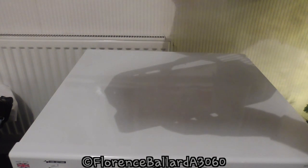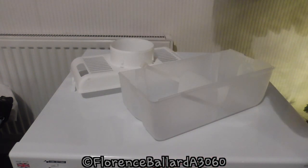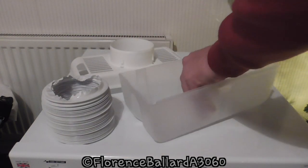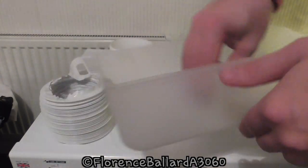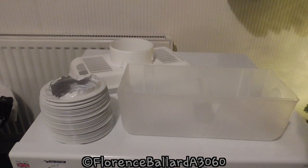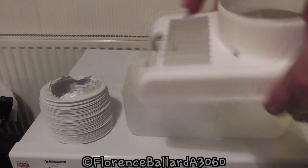There doesn't seem to be an instruction sheet included. You have two little clips — it pops off — and you have a spare hose in it, so don't worry if your dryer doesn't already have a hose. There's also a cable tie for putting it together. And your actual condenser here with this little chamber. What you do is normally fill it with water or ice, or you can use those cooling blocks that you use on picnics. You're meant to fill it to about two-thirds full. Place your dryer hose on the end, secure it with your cable tie, pop it back on, and it catches all the lint that comes out.